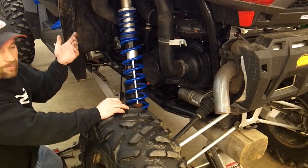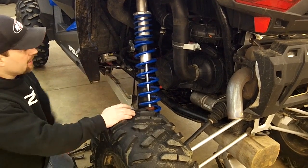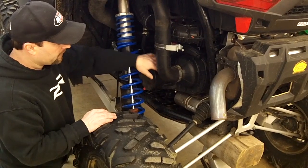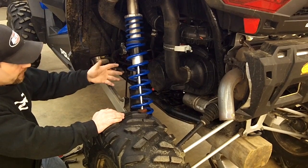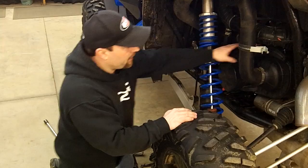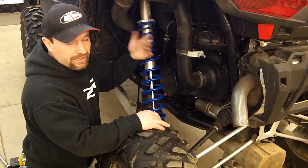We've had this thing apart probably 60 different times. Every time we do it, for the first few times until you actually ride around, it'll do that. Usually it's just the clutch will rub on the cover or the belt might be hitting someplace. Usually once you ride it a little bit, it goes away. We've never had an issue where it's worn through or anything like that. It doesn't matter what you're doing to it. It seems like whenever it has this cover off, it has to kind of self-realign itself. So just a heads up on that. If you have something apart and it sounds really nasty, that's probably what it is.